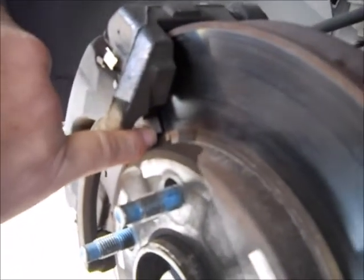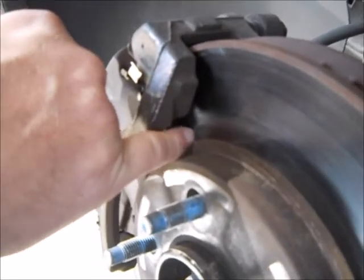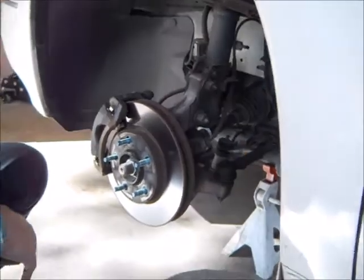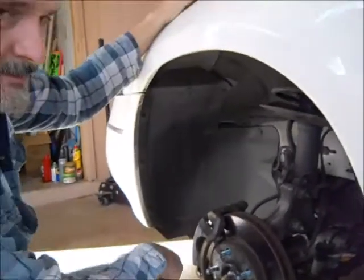This little metal piece has a gap right there against the disc brake. That gap will stay there until the shoe wears out — then when that metal comes in contact with the disc, you'll hear a squeak and you'll know it's time to change your disc brake pads. Looking around this entire wheel assembly, I see no leakage of brake fluid. I assume the disc brake calipers are good and not leaking. So again, we're going to put the tire back on and then check the back.